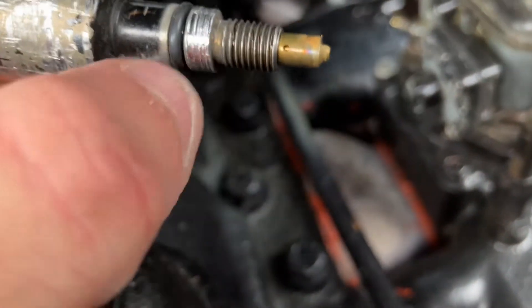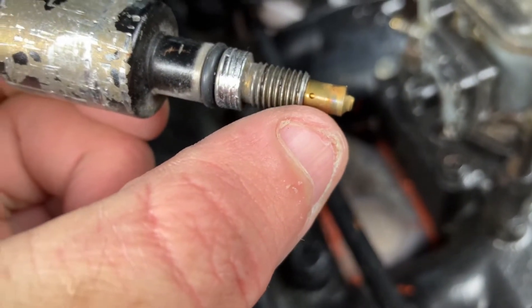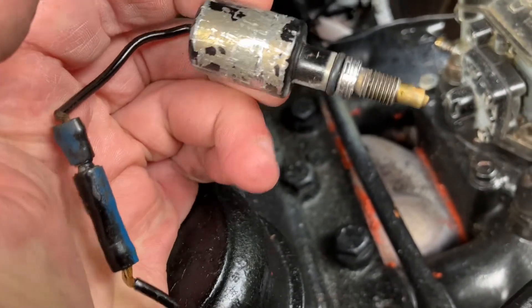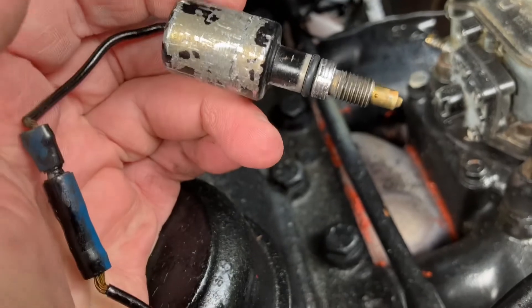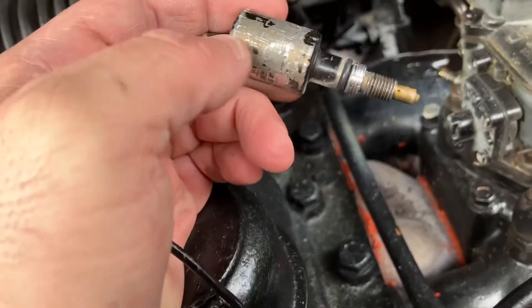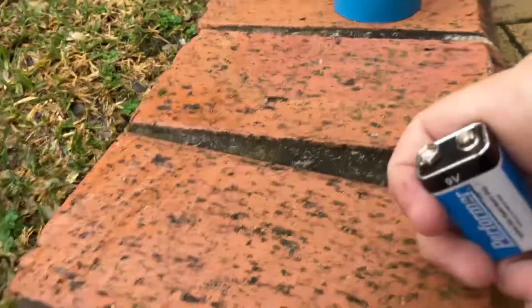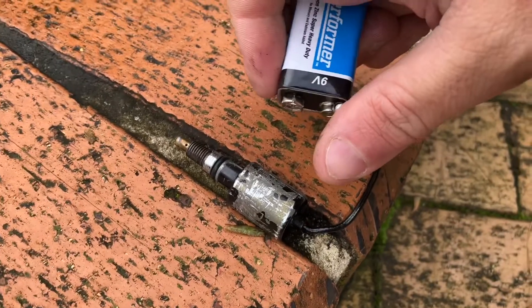This one's a funky one. Usually there's a needle that actuates in and out, but this one actually has the needle actuator inside with the little fuel holes. When you turn the key, this is meant to click back and forth and mine isn't. I cleaned it out, disconnected it, and tested it with a nine-volt battery — and I can actually just actuate it with the nine volt.